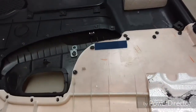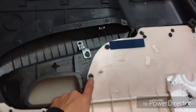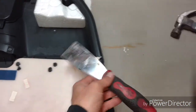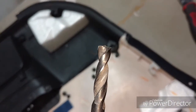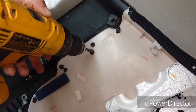What I normally do — you can either take your scraper and pop all the heads off with the hammer, that's one method. Or you can take a spot weld drill bit, which has a little point that sits right in the center, and literally just drill it until the head of the plastic pops off — that separates it nicely.